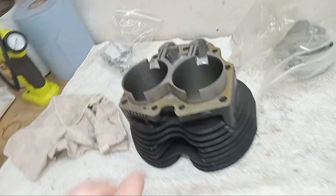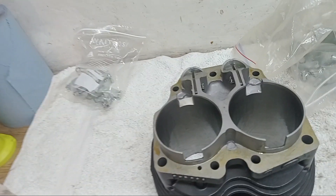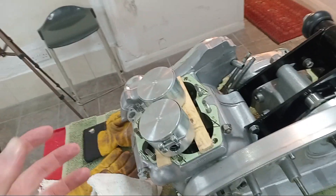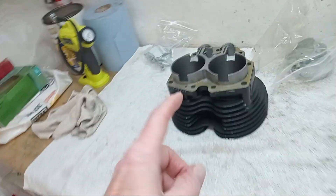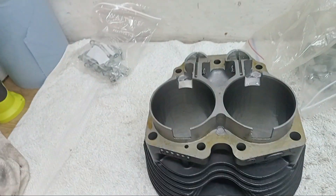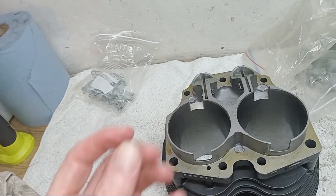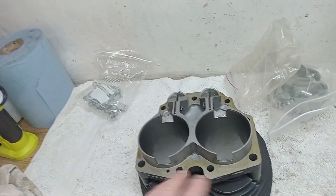I've put just a smear of oil inside on the barrels. On older British bikes you have cast iron cylinder piston rings. They're cast iron and what they're designed to do is act as big oil scrapers - they go up and down the cylinders and scrape off all the little high spots of metal. You don't actually want too much oil in here because it will stop the rings from bedding in - they want to scrape against the barrels to scrape the oil and metal off and bed in. On the other hand, I don't want them going rusty before the bike starts.